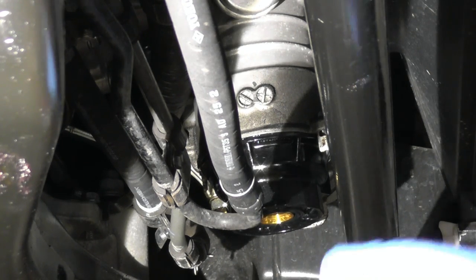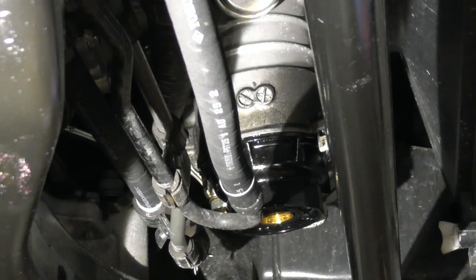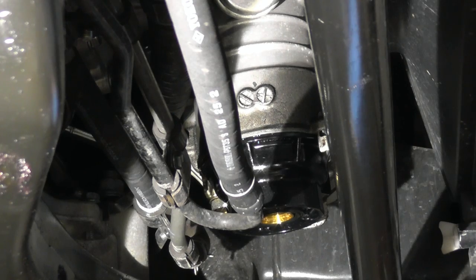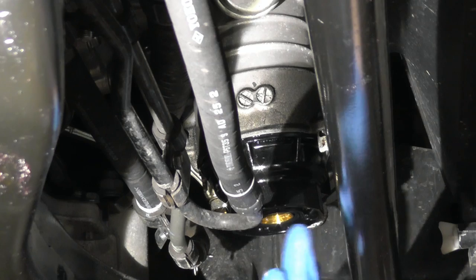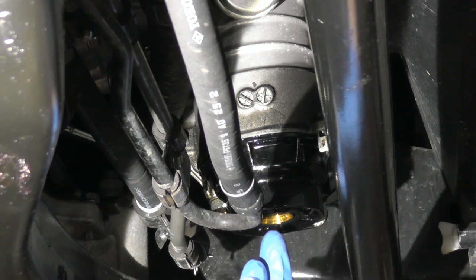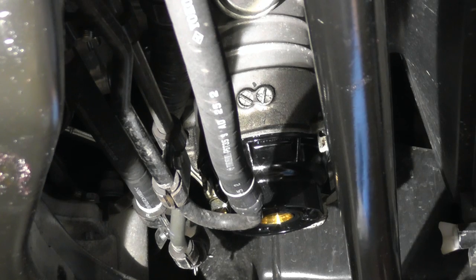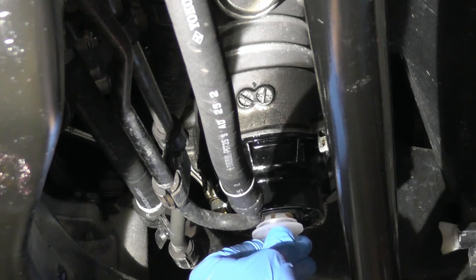So, next step is to relieve the pressure. This piece here, I'm not sure if you can see or not, comes with a filter. It's made for this purpose. Do you have to remove that, like a bolt from here? My recommendation, yes, every oil change, because there's things or old oil that gets trapped inside there, and it's not good when you start circulating old and new.